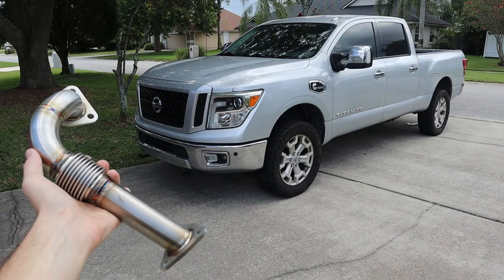I thought the problem was the fabricated up pipe with block-off plates — my logic being that on 6.0 Power Strokes, when you just block it off you cause weird airflow issues, and Duramaxes have issues like that too. So I got a CFT up pipe for about a thousand dollars. The EGR delete kit from the machine shop was around $350, which is a lot cheaper than getting an EGR delete kit anywhere else, so it's still a success in my opinion. But the up pipe did not fix it — my theory was completely wrong.